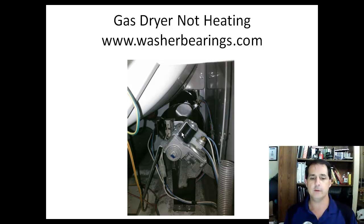The next option was this coil here. I didn't really consider the thermal fuse because the igniter worked. Typically, when the thermal fuse blows or opens up because of heat — so you don't have a fire — the igniter won't work after that. They lock that out when the fuse blows; it's a protection safety feature. So my next option was to replace these coils. That's the next thing to go: you've got the igniter, the thermal fuse, and then the coils.